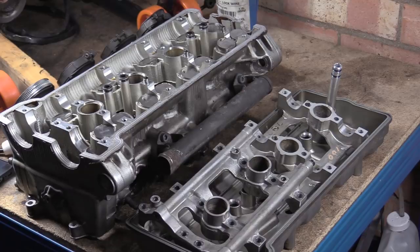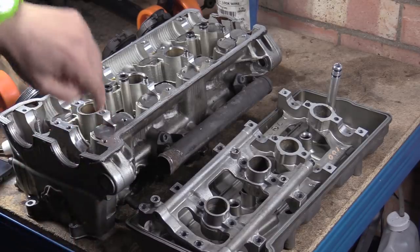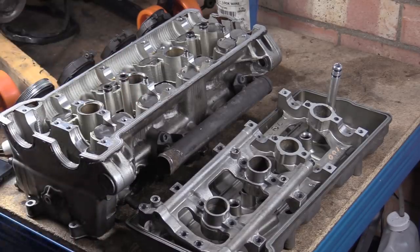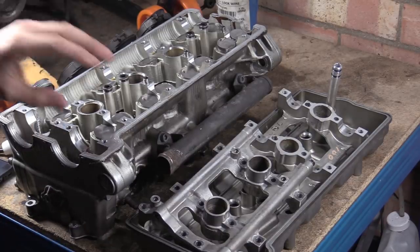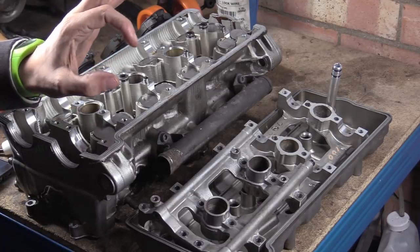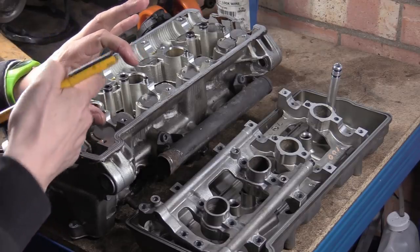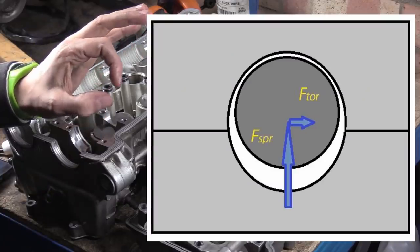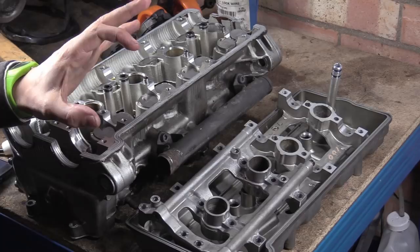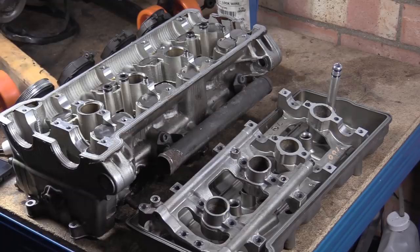once that's happened, that hole and the clearance between the camshafts and this bore is fixed. It has a spec, and there's an oil clearance in there. As these start to wear out and wallow out and get bigger and bigger, the oil pressure will drop. Regionally, it won't drop because the camshaft can now move and accelerate a bit quicker, which means there are more forces involved. But as this wallows out, the outlet for the oil is getting larger and larger.